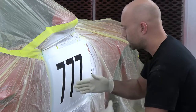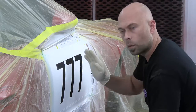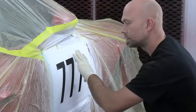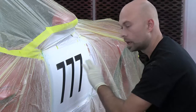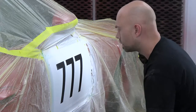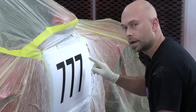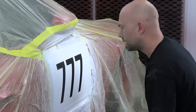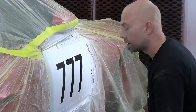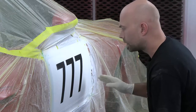Because I had to tape out and cut the black by hand, I had nice clean tight lines and I don't have to worry about anything — the sealer is a hard surface, very durable in terms of taping on it and not leaving tape trace marks. A lot of colors have a tendency to stay a little tacky, but the sealer does not, so it's a very nice even surface to work on. We covered until we got rid of the 20, let it dry, did a drop coat of hot rod sparkle white for the effect coat, and then taped out and did the sevens in wicked black. We let it sit overnight before doing the numbers — it's the second day now.